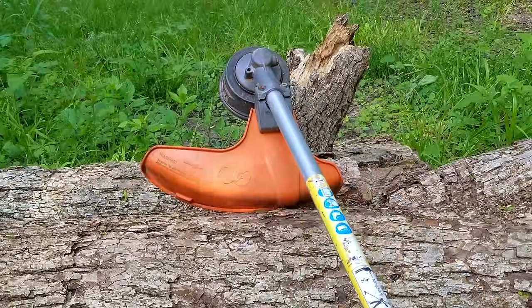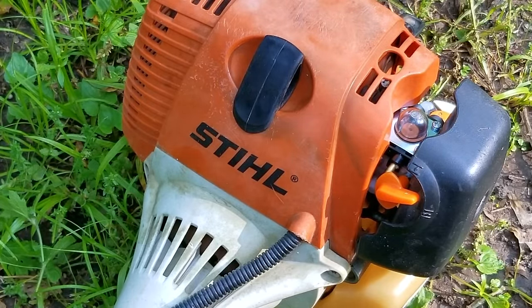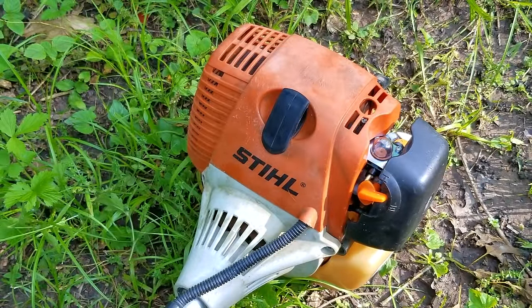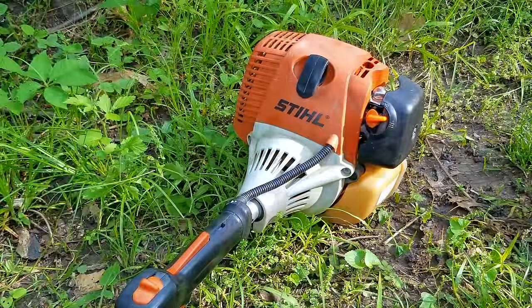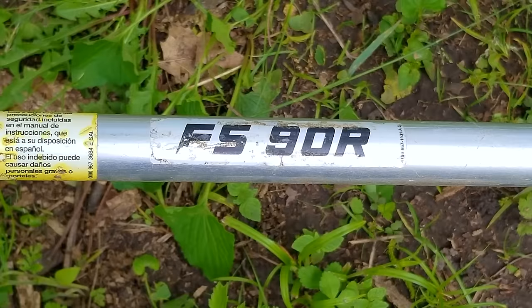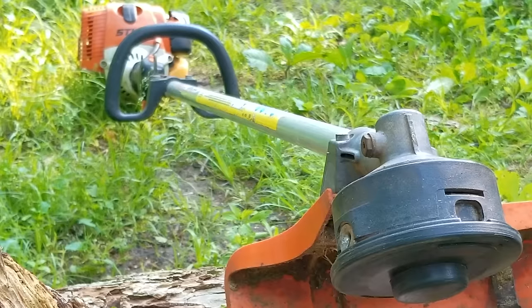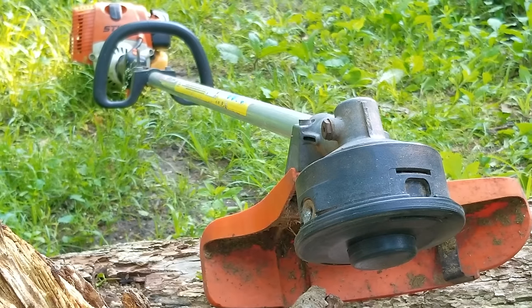Another reason why this trimmer would have a running issue is because fuel may have been left in the tank during winter storage, which here is about four and a half months. I've heard from a lot of viewers who say they don't do this and have never had an issue, but I think it depends on the area you live in and what type of fuel you use. In my experience, it's just best to drain the fuel out and run the machine until it stops. In the end, this trimmer is running again, and hopefully they'll take better care of it. So my question is: do you leave fuel in your trimmer during winter storage, and if so, why? Thank you for watching — please feel free to ask me any questions about this project or your own projects, and I hope to see you in the next video.